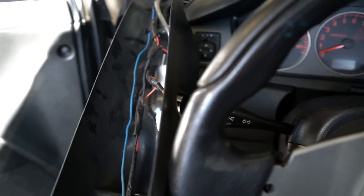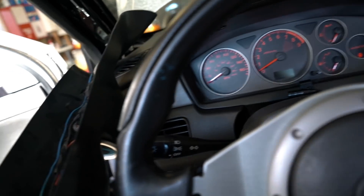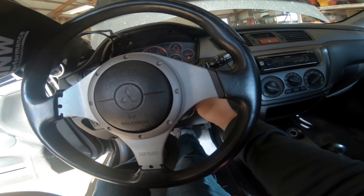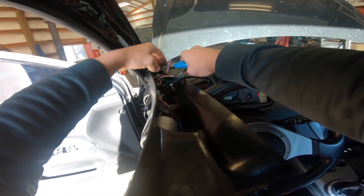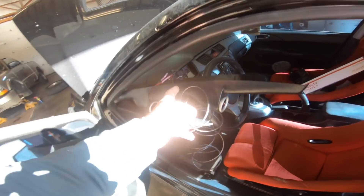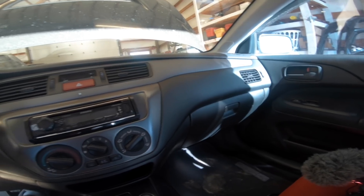If you don't already have existing gauges in your car, you can tap into the radio for power, there should be a fuse box under there, or you can use the cigarette lighter — there are so many different places you can pull power from, so it's not a big deal. I have this long black wire and I'm going to run it from the blue wire on the AEM gauge harness all the way to wherever I want the serial cable to come out — I like mine in the glove box so it stays hidden. I have to run it down underneath behind the radio and into the glove box, shouldn't be too big of a deal.